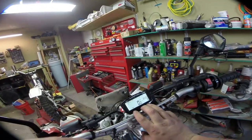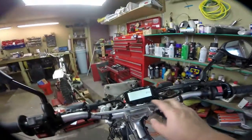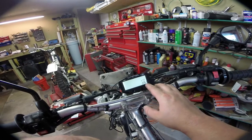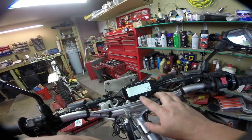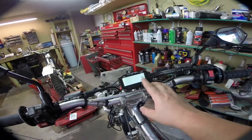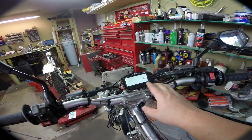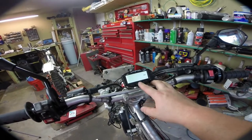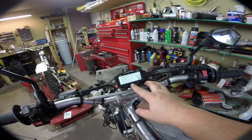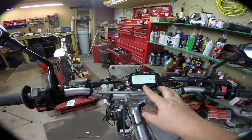Now you need to program it. To do that, hit all three buttons at the same time for three seconds. First you set miles per hour or kilometers, then your tire diameter in millimeters times 3.14 for the circumference — in our case it's 2,261. Then you set the time format; I want 24-hour format. That's the current time — 6 p.m., 40 after. This stays one. This can be changed if you're on a sports bike. This is pulses per revolution — that's if there's a phase shift, which is not applicable to this bike. This is our temperature setting.